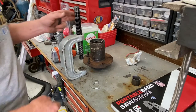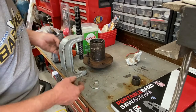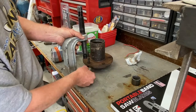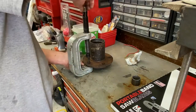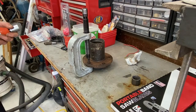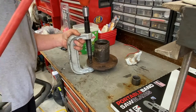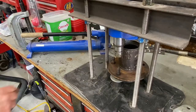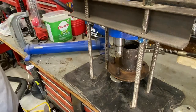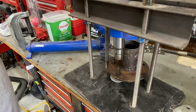Here's another method I like — this is from Harbor Freight, it's called a three-in-one tool, it's for doing universal joints and ball joints. It wasn't level on the back so I have to use this washer, and if you have an impact wrench this goes pretty easy. Probably the easiest way is if you have some sort of hydraulic press — this is a homemade one utilizing a porta-power.